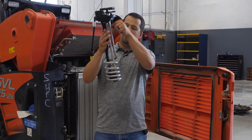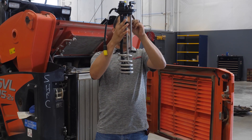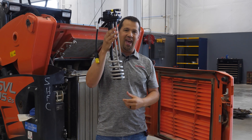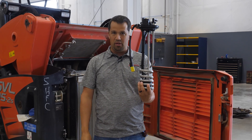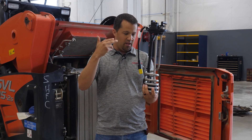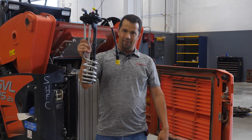On this silver pin right here that runs right down through the middle — if I flip this upside down you'll see there's a float on here. That is the level indicator float for your tank. So this one assembly right here performs all of these functions: the heating, the dipping, the monitoring of quality, the measuring — all done by the DEF header.